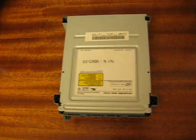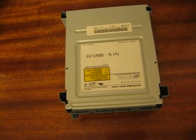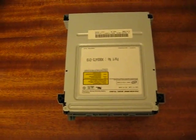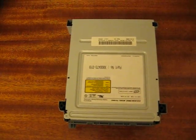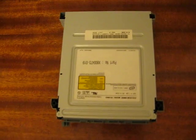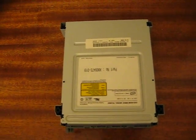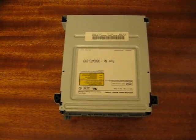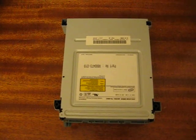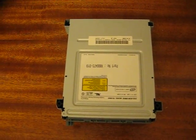For the reading issue — if it says 'reading' on your screen when you put a disc in, you might need to buy a new DVD-ROM too. As it's not holding the game disc, the top needs to be pushed down a little bit more above the DVD-ROM, so your best bet is buying a new one and just doing a DVD-ROM swap, which is not that hard once you get into the 360 and get your DVD-ROM out.